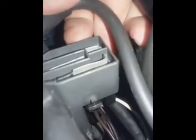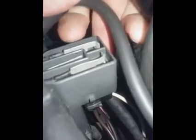If you watch those terminals right there up front, the two that I just pointed out, watch, they're raising up there, completely raised up like that. What's happening is the actual terminals down inside the connector are pushing that up, because these aren't pinned in hard enough. And that's because it's just cheap material.